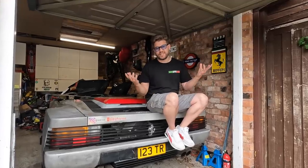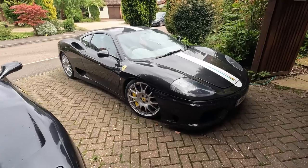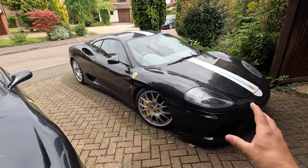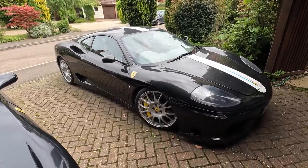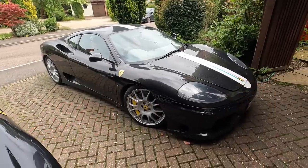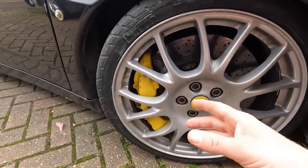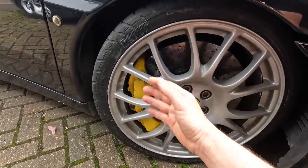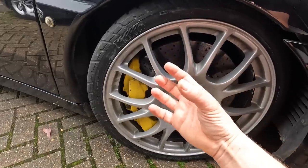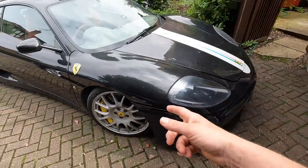This video is sponsored by Athletic Greens. Ferraris can be expensive to maintain, but that's not exactly shocking news. However, over the years I've often found that with most jobs there's a way of saving money. Today's job is all going to be done back on the driveway in true Rata Rossa style, and it's all to do with the brake system on my Stradali. The Stradali uses the same carbon ceramic brake system as the Ferrari Enzo, and it's notoriously expensive. It also suffers from a common problem with the calipers, especially the fronts - the pistons seize, causing the brakes to bind, make a horrendous noise, and not work properly. That is exactly what is happening with this car, so today we're going to fix it.